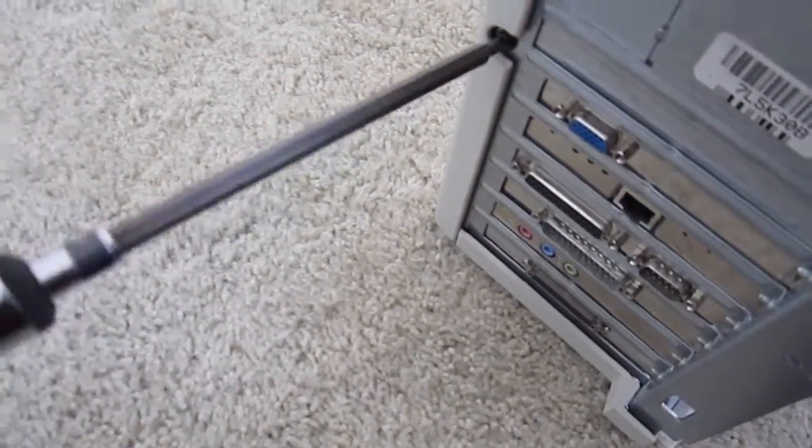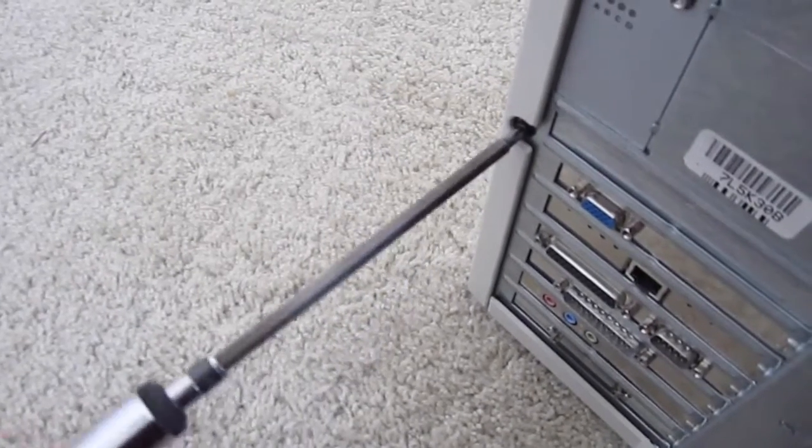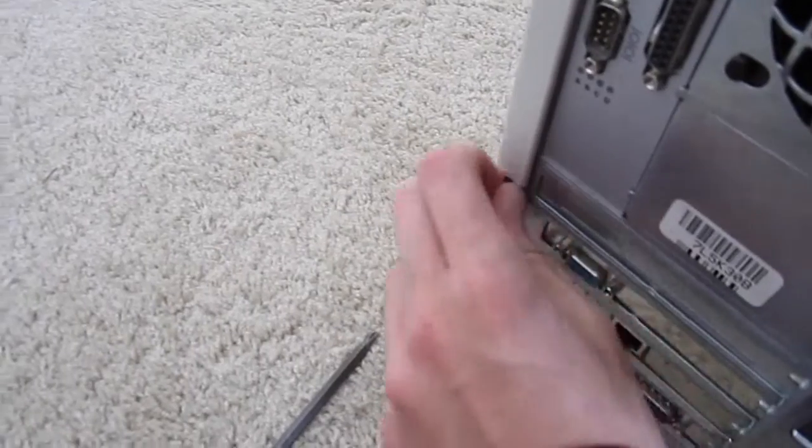You want to be extremely careful because this is old plastic. You've got four screws right here that we're going to take off, but you can actually take off this old metal assembly. There's another way you can get to the screws — I'm going to show you that by removing this little screw in the side panel. The screw comes out like butter, and this may require two hands. There we go. Pretty straightforward, and there's the screws right here for the optical drives.